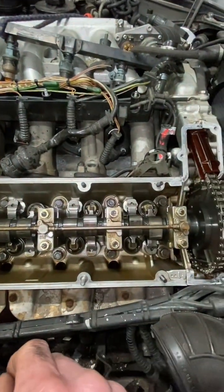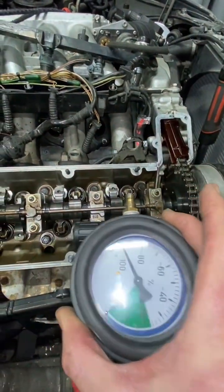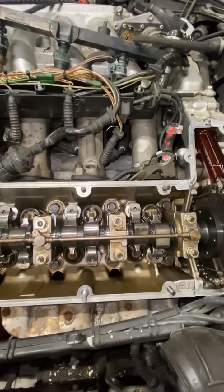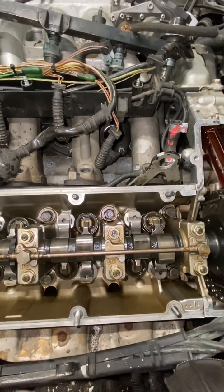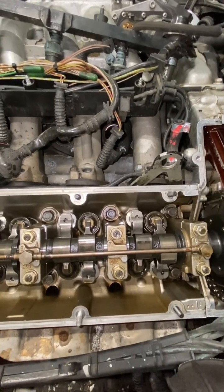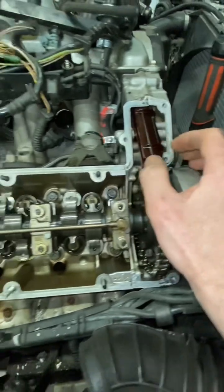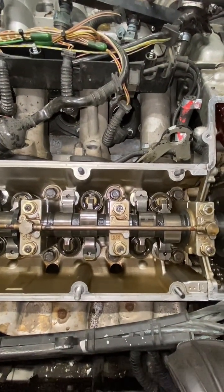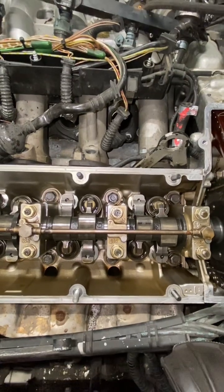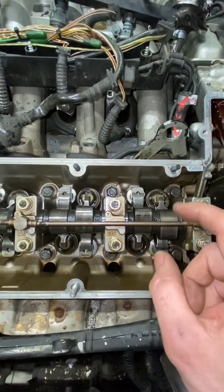Good spark. What did we find on the engine? I used a cylinder leakage tester — I got only five bar of compression, not enough compression, but good cylinder leakage: three percent loss, which is fantastic. Because I was able to manipulate the engine into the position I wanted, I knew for a fact I had no loss of compression or leakage in the cylinder.